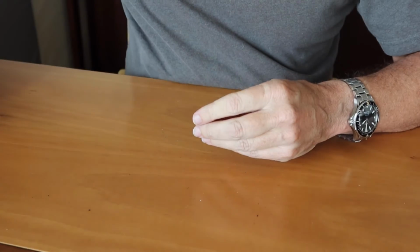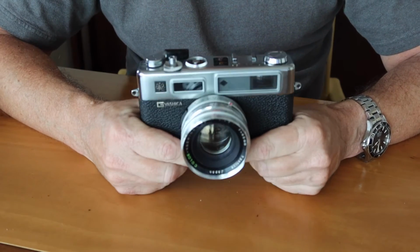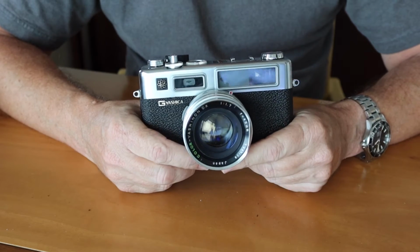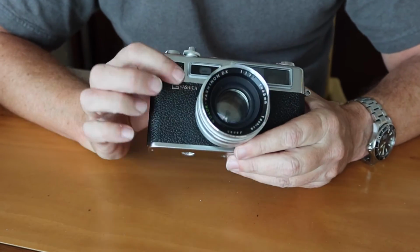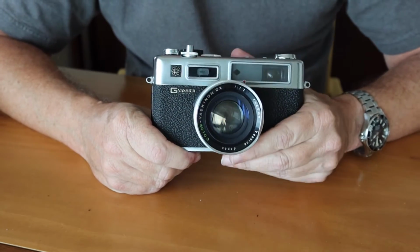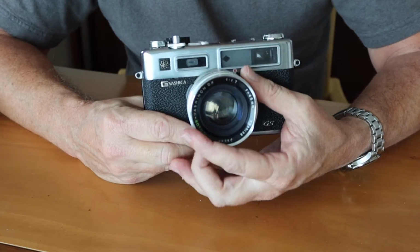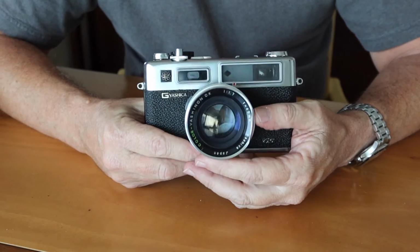All right, moving along, we'll go to the other improved version, and this was the GS. Now, the GS had some great improvements to it. Starting with the G and into the GS and later cameras, the electronic contacts inside the camera were gold-plated. And that was the contacts for the auto switch, for the aperturing, and for the shutter mechanism. And this was for a few reasons.